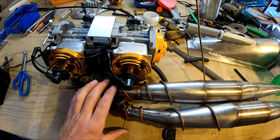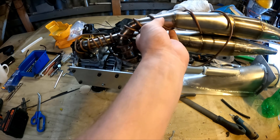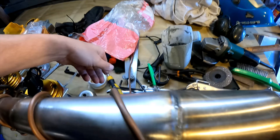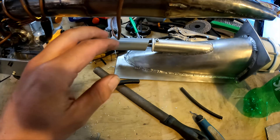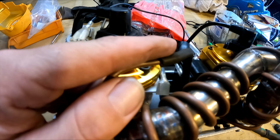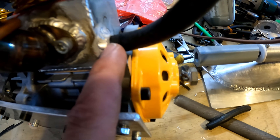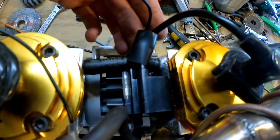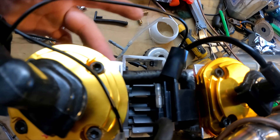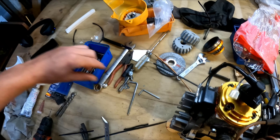Just like that it's all together. I've wrapped this copper pipe so the water is going to feed in this line here, weave around this pipe, go through a rubber hose to the other pipe, weave around that pipe, back down into the engine, through the casing, through the water jacket, through this pipe into this water jacket, and then exit out there — out the front of the board so I can see the water coming out. Time for a get-ready-to-run first-person montage.